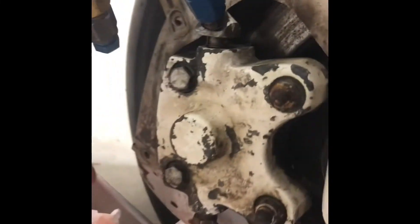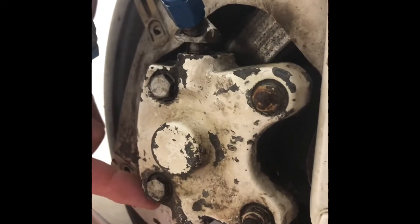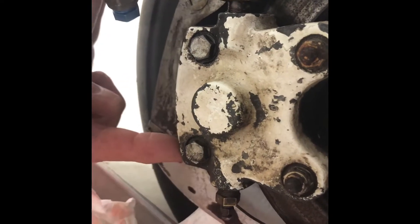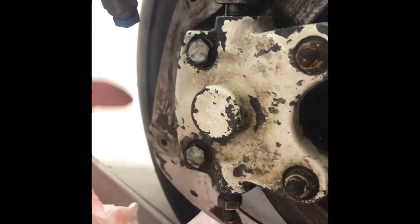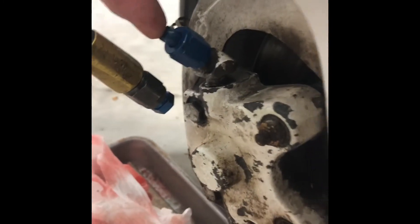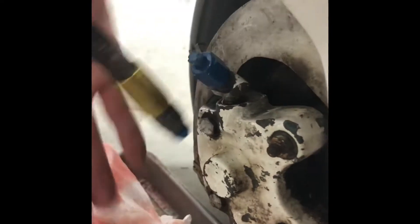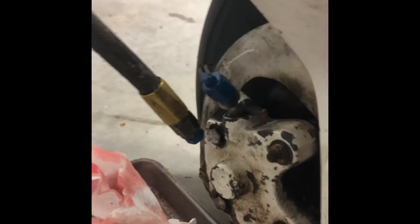Got a leaky brake puck — the brake puck will leak from here. Usually you can tell by it dripping out of the caliper. If you do an inspection on the plug and everywhere else, it's usually leaking out of the backside. We're gonna change the o-ring, clean this caliper, and do a service on it. Disconnect your lines, put some caps on — you'll get a bunch of drips, so get a drip pan ready. Take out the bolts, the caliper will slide out, then we'll break that down and clean it and get it ready for a new o-ring.